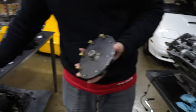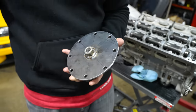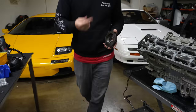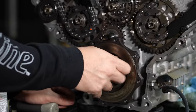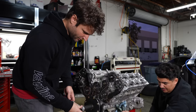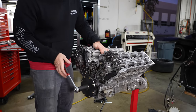Isaiah made this custom piece — it's funny because we spend all day working on these things and none of it is actually the IndyCar. This piece turned out really well. We're going to go ahead and put the flywheel back on and use that as the correct surface to apply torque to this motor. Last night I verified the engine's rotation multiple different ways — it's the same as a rotary engine.